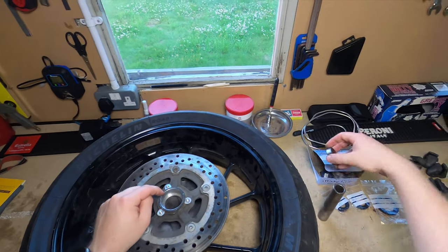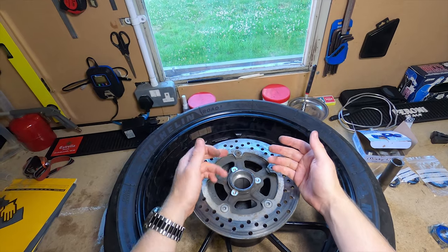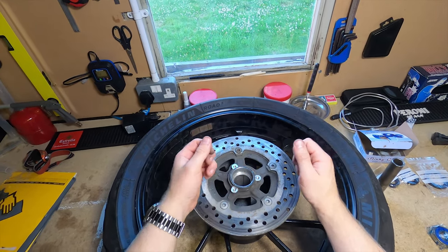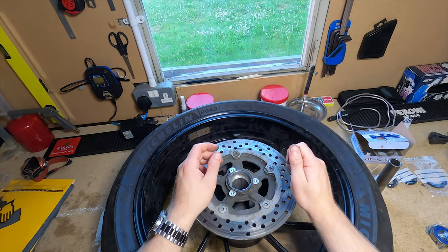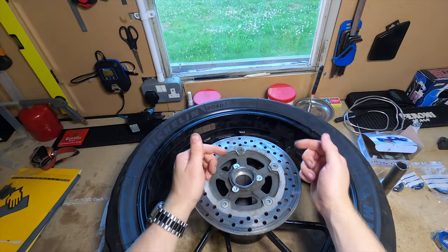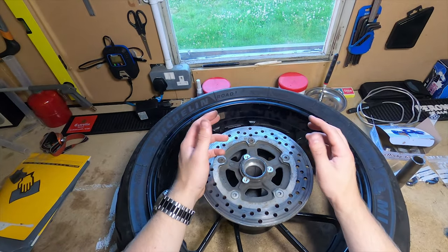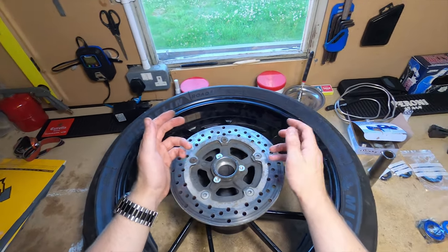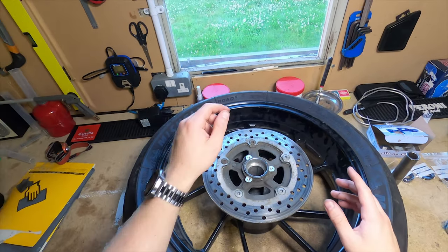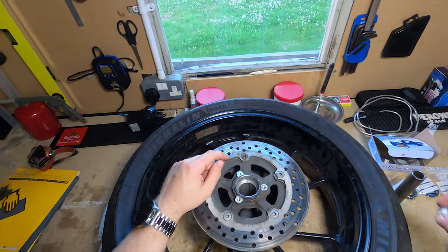And this one, the problem with it, because it had all crushed, all the ball bearings had fallen out, the inner ring had fallen out. There was no way to pry it out. I tried heating it with a blowtorch. I tried hitting it from the other side. I tried various different tools that sort of make a kind of bearing puller. Didn't work. What I actually ended up doing for the last couple of evenings, well, I'll show you.